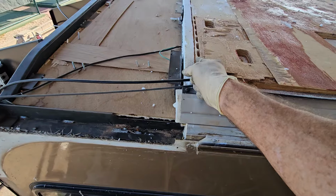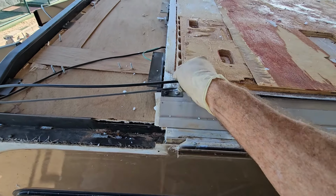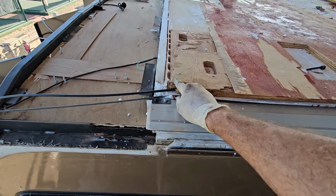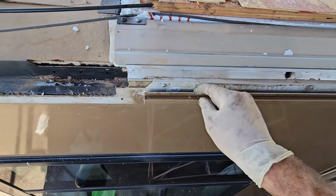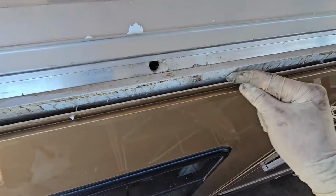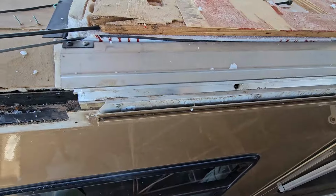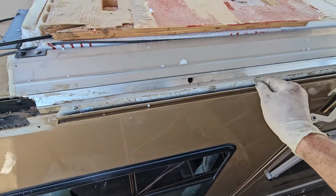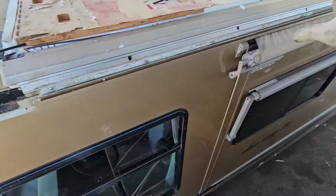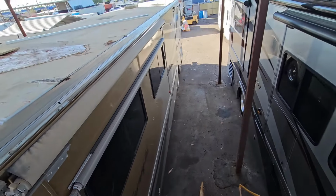Because remember, they didn't take the front cap off, so the original Winnebago stuff was underneath there, and there was a seam right there. So he did tell me that. And then on the sidewalls right there, that's supposed to be more of a urethane-based adhesive to keep the roof from untucking. They just used clear silicone as a cap seal over the top, which is a weird choice to me too, because this is a full-body paint job, and you can't paint silicone.